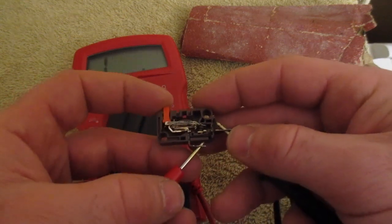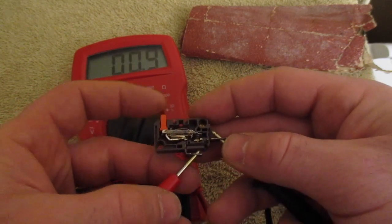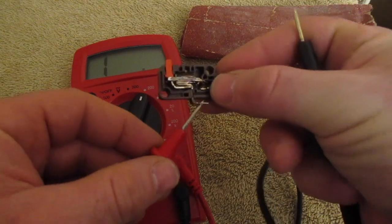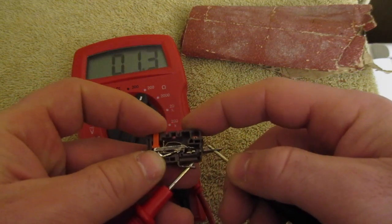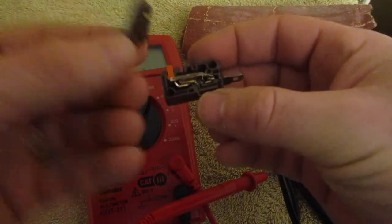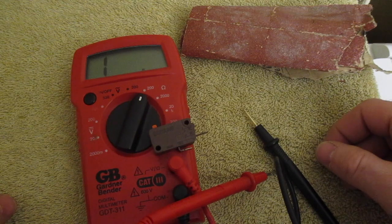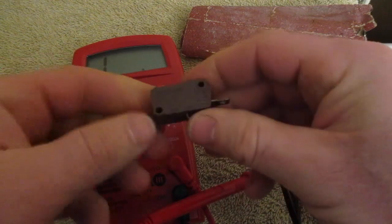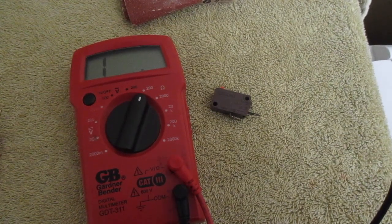As you can see, there was a burn on this. I was able to clean that up, and I'm not sure how long that will last. But if you are in a predicament and you're not sure when your new parts are going to come — this one wasn't too bad, so I was able to just polish off that burn. You could put this back right into your microwave; it has clean contacts and you'd be good to go again, maybe forever or maybe for a short while. That is how I fixed a faulty microswitch, and it cost me nothing. Thank you for watching — check out one of my other microwave repair videos.